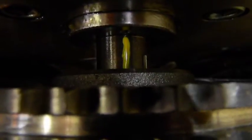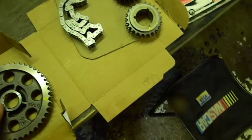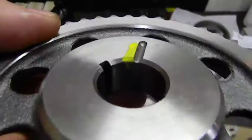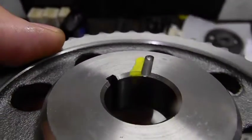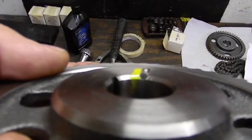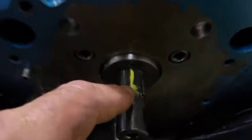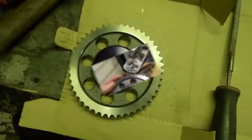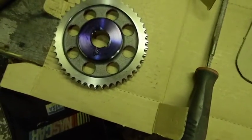If I double the width of the notch they have, we're good. So like I said, it's not the timing chain — it's the cams that are drilled wrong, and I think all these blanks are from the same people, so this is something that's always going to continue. Look at the yellow witness mark I put on here — if you put this together as-is, you were going to smoke it. So let's start drilling.